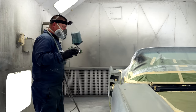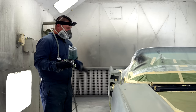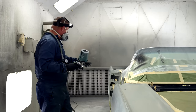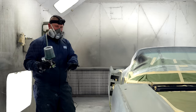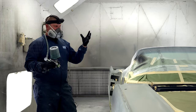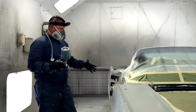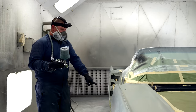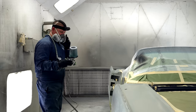So I'm gonna put this around my neck and we're gonna seal the car, and I'm gonna make a mental note. Right now I already know as I seal this car that area of burn through is really my only spot that I have as a concern as I go through this. Everything else is going to seal just fine, but remember, that's porous, and I know that's going to soak up. So I'll just give it a little wet sand, and I'll reseal it.